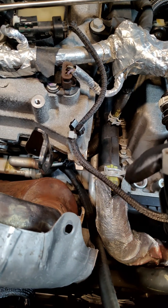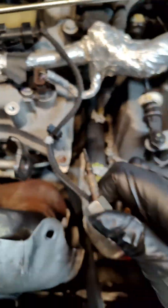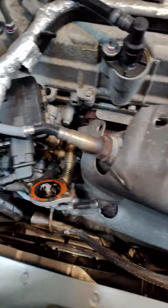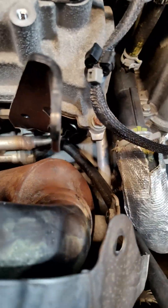On this other side where the black hose is attached, there is the EGR probe. You're going to need a 17-millimeter wrench to unscrew this — it is tight quarters, so it's probably easier to do by hand. You're going to clean the tip of this probe that's inside, and then attach a rubber hose.